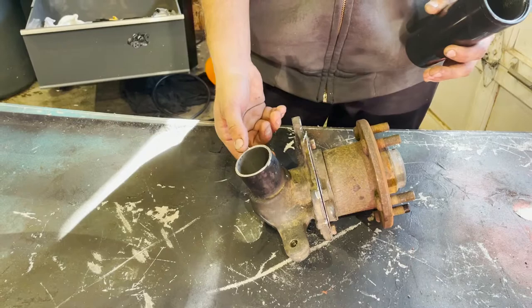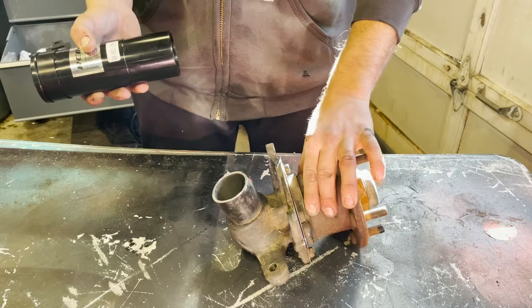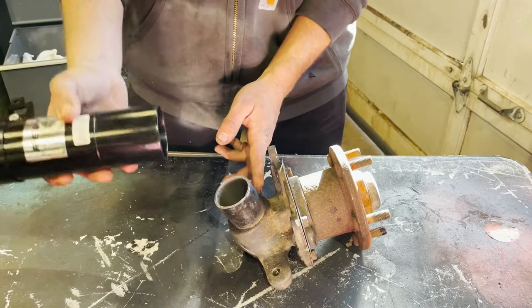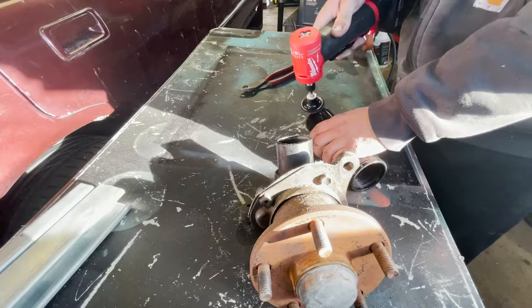Cut off and left about 45 millimeters on this. Take your sleeve off your coilover and there you go — it should fit right on there. Next you're going to have to clean all this up and clean the whole bottom base as well for welding, because you want a clean surface. I checked on removing the dust shield — you can take it off with the bolts, but then this area is exposed and will get dirty. So what I chose to do is cut the dust shield and leave it bolted up, because it should help keep this bearing area from getting as much dust. Next I'm going to prepare these areas, get the welder out, and start laying some fat beads.